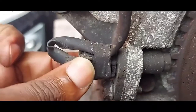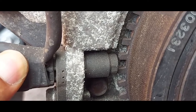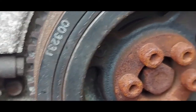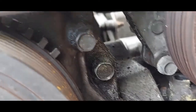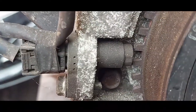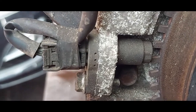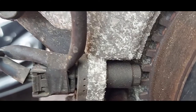What does it do? This sensor is responsible for determining TDC. As you can see, the teeth are dotted around the wheel, but when we come to this side, you can see there is a massive gap — that's what determines our TDC. This sensor reports to the ECU about TDC, and it is also responsible for engine speed.